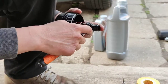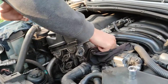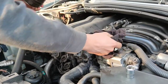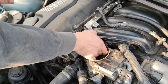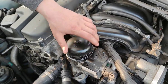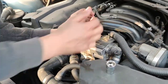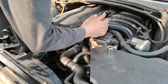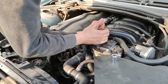Throw away the old O-rings and put the new ones in. Then put back the oil filter. Before putting the oil filter assembly back, make sure you clean the whole area — don't leave any old oil there. Now we can put back the oil filter assembly. Tighten it with your hand first and then tighten it with the tool. Don't overtighten it — for oil filters generally it's 10Nm, which is really easy to reach.